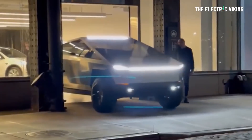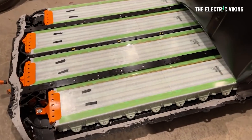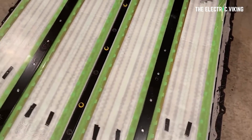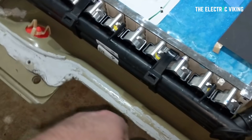The new pack isn't a structural pack like the Tesla Model Y and the Cybertruck will have. It more closely resembles the Model 3 current design, with individual modules that are one solid chunk of cells bonded together with a material that acts as a resin and has fire-retarding characteristics. We don't know whether Tesla is using the same assembly technique as the Model 3 modules, where bandoliers of cells are glued to the tube first and then assembled into the module — Tesla had problems getting the bandolier system to work at first. The two-pass U-Flow cooling tube is mentioned in Tesla's patent app for the integrated energy storage system, and is called out at 3:30 in the Engineerix YouTube video 'Tesla Model S Plaid battery torn open.' I'll put a link in the description below to that video.